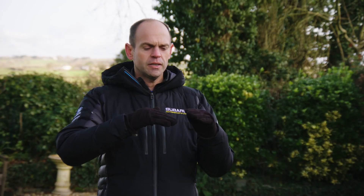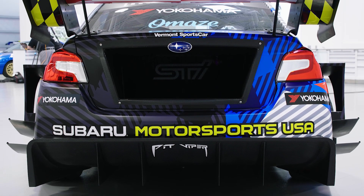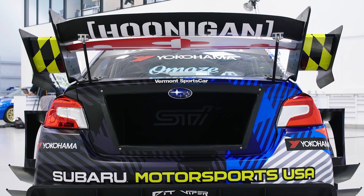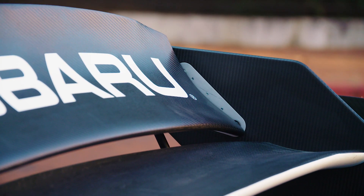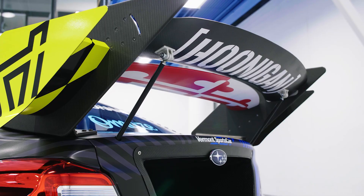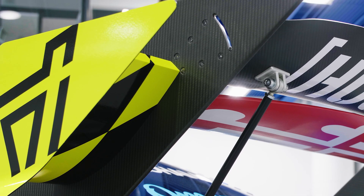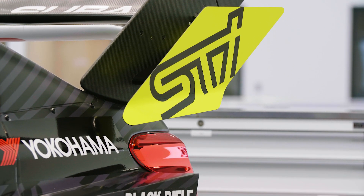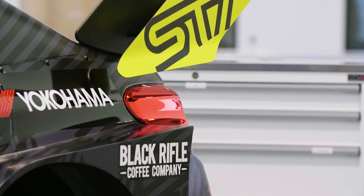The rear wing is a double element with an active upper element. Mainly its primary function was to activate it for when the car is in flight — the car should be able to jump extremely long ways and we don't want the nose to drop. It's also got two extensions with additional side plates so that when the car slides, the air hits those end plates. They're big flat surfaces, and that prevents the drift from becoming excessive by the air hitting the end plate of the wing.